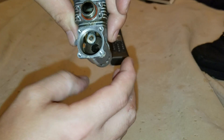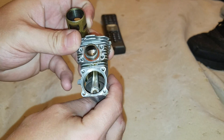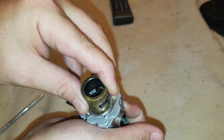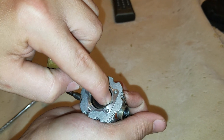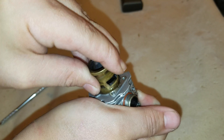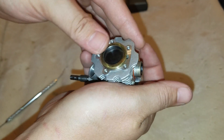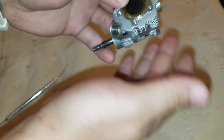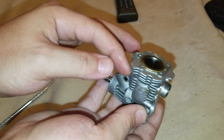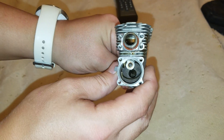You need to bring it to top, and in just a second I'll go over top dead center. Then you take your sleeve — you want to keep the piston at the top, get the sleeve over the piston first. There's a pin right here, a little metal pin, and there's a slot cut into the sleeve — line those two up. Some motors you have to heat them up for the sleeve to come in and out, like the 2.5. Now push it all the way down. Those ports have to be aligned with the grooves that were on the side, the front, and the exhaust port at the back so everything will work correctly.